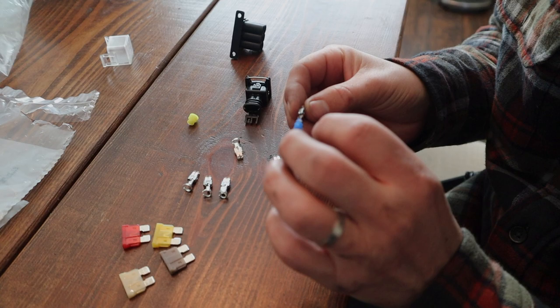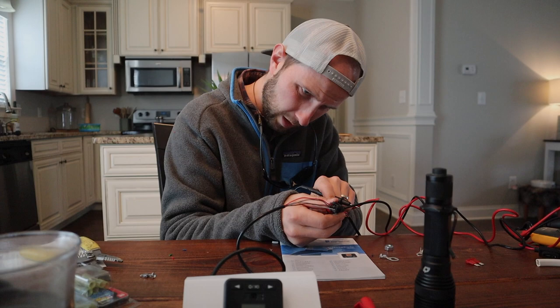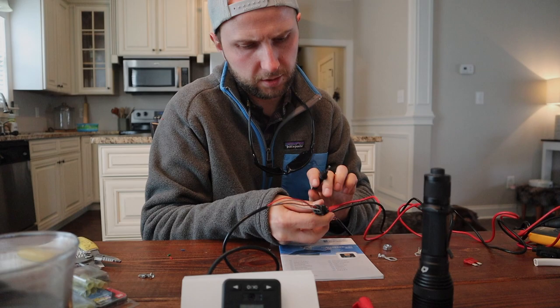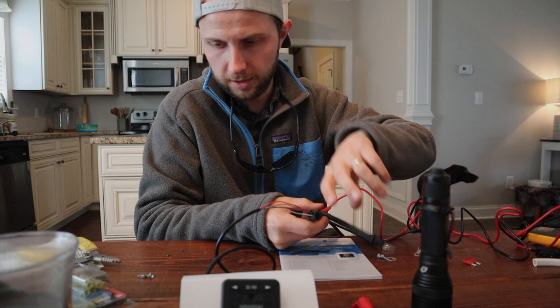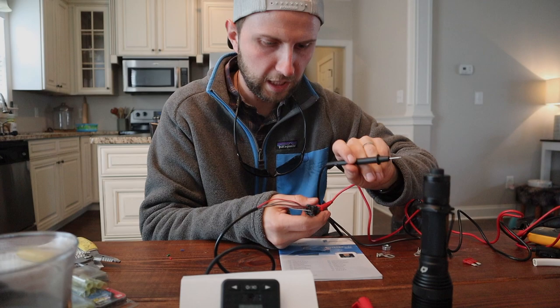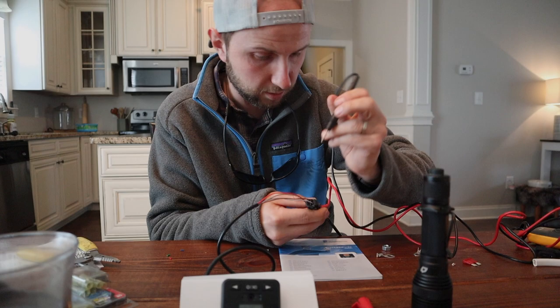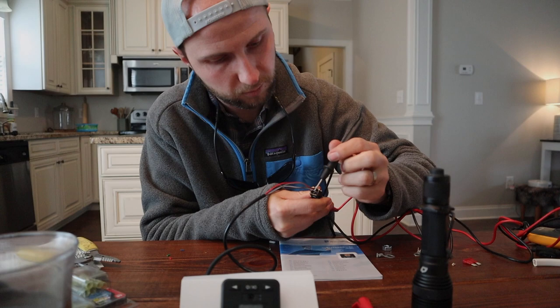This thing's quite a manual process. You've got to crimp these small clips onto each wire and then slide them through this plastic housing and create your own electrical connector. I've just had to let Jared take over on this because me and electrical don't really mix. So because they don't like to do plug and play electrical components with these kits, I have had to wire up these tiny little gizmos — these little fuse holders — and these other little inner clip electronics. I wired them all together and now I'm just checking to make sure I haven't screwed something up. Right now it looks like I have certainly screwed something up. Can't get this wire to show connectivity.